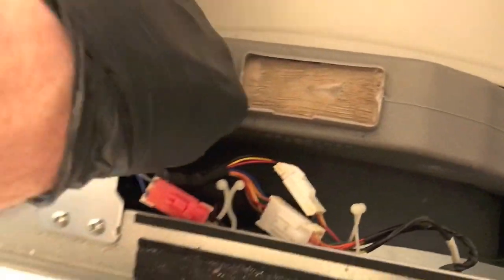After you put the new tub seal on and secure both hoses and clamps and electrical connection point for the light, I want to point out the next thing. On the back side, that same little lip that we were talking about earlier while taking it off, there is a tapered lip on this portion of the washing machine. You want to shift this up and over into place, and do that along the entire portion of the tub seal.